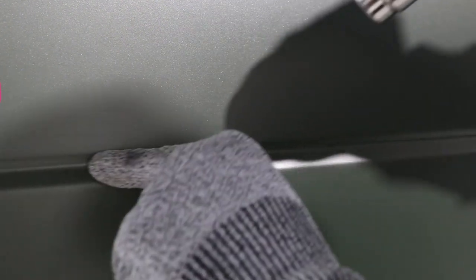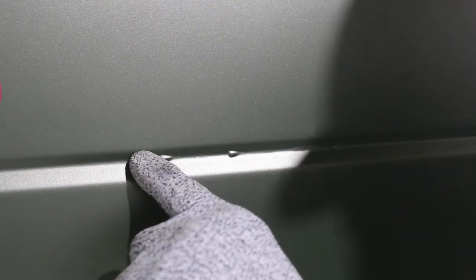What we're going to do is heat it and hope that we can push this down and maybe even post-heat it afterwards. As we have air in here it's going to get stuck. Right now I can see there are no real glue lines or glue rings, which means the film hasn't separated from the adhesive. On top of that, the paint isn't lifting and there's no dirt behind it. So it could be one of two things: just too much stretch for the film, or this area wasn't cleaned properly. We're going to poke a small hole and get in there and heat it down — poke a little hole, heat it, push it down. Now we want to post-heat this.